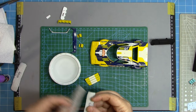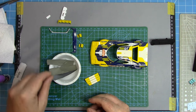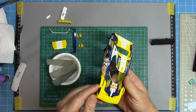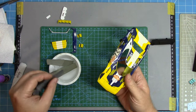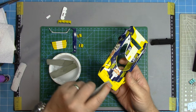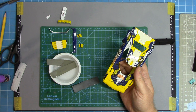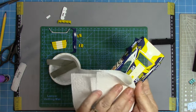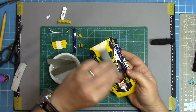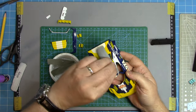The bodywork's 2K has been curing for a couple of weeks and is completely hardened, so it's time to attack it with some Micro-Mesh just to remove any flat spots on the high spots and flat it back a little bit — it can greatly improve the appearance of 2K. Starting with 6000 Micro-Mesh, wet sanding using some water, then progressing through the grades — I think it's 6, 8, and 12 — going back and checking, drying it off, and progressing around the body until I'm happy.